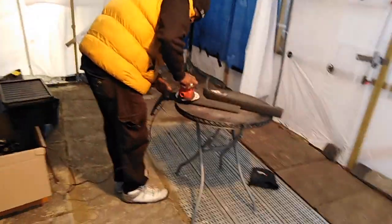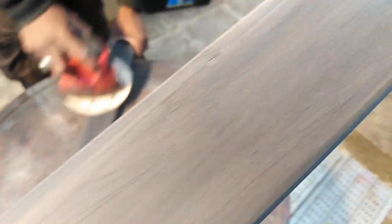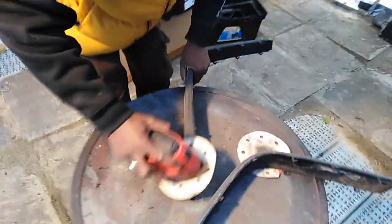Let's see what Duke's doing. Yo Duke, how's it going? That's the finishing bits from the E34, nearly ready. This kind of surface is very hard to get perfect, so best thing to do is sand it down as much as you can, then primer it with a couple of coats — primer will make the surface harder, then give it a sand again. That will make it nice and smooth. We'll see how it goes a bit later.